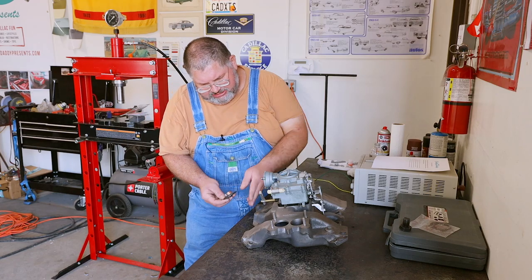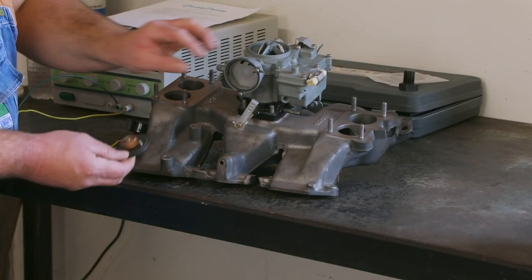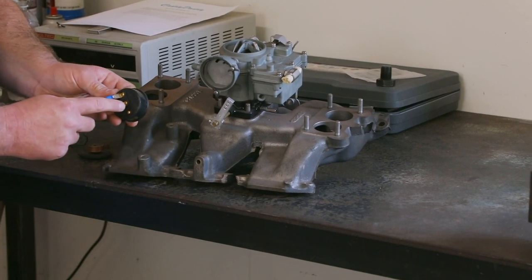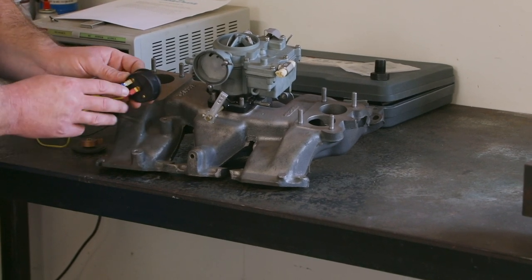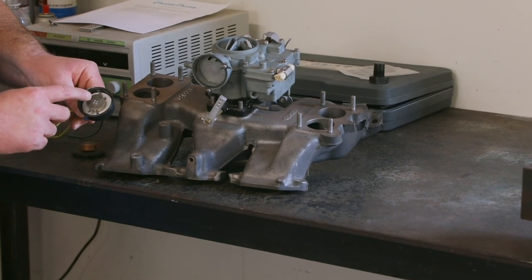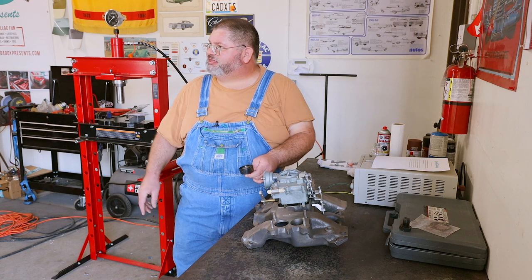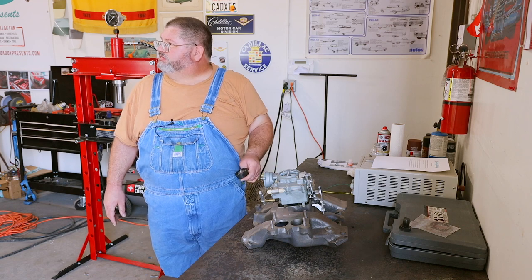On this one here, it's the heat of the cool air being sucked through the tube and warmed and brought into the housing to operate the spring. The electric choke has an electric heating element. So on this style, the tube to the stove would be coming out the side, or on here. And now we have electrical contacts. And so as electricity is applied, it'll heat this backing plate, and that'll operate the spring. So we're gonna set this up here on the power supply and do a time lapse so you can see the spring move. And then we'll get back over onto the 64 and get working on doing the conversion.